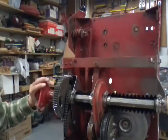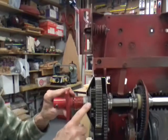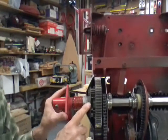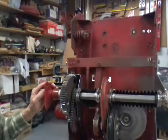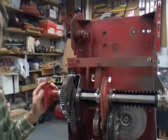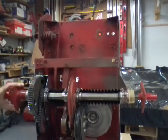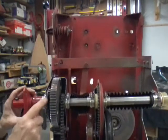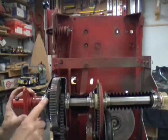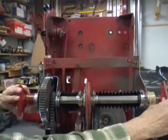That's typical because the differential is turning. You can see these small gears in here — all that's doing is turning the tire on the other side in the opposite direction. So if it's doing that, everything in your gears is okay. Now if you can hold this tire and turn this one...